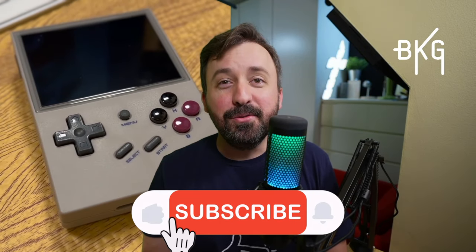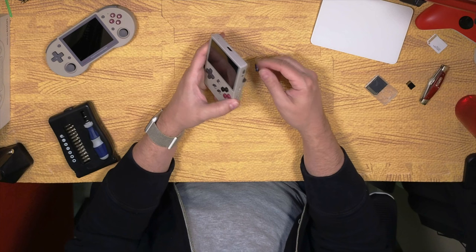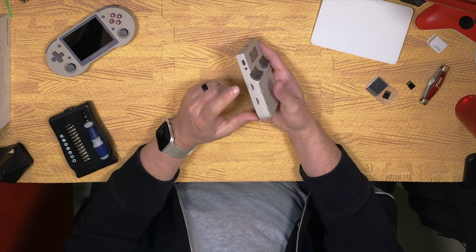which I cover in my review here if you're interested — we have to actually disassemble this handheld. I know from a lifetime of experience that most people are nervous to take apart their electronic devices, so I'm here to walk you through it. To do this, you're going to need a Precision Screwdriver Set with an H1.5 hexagonal screw head. If you need a set, you can help support the channel by purchasing one through the link in the description at no extra cost to you. Once you have that, you're going to remove the SD cards.